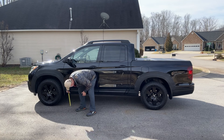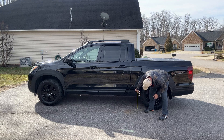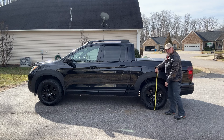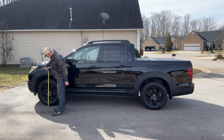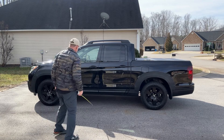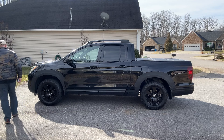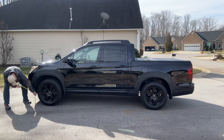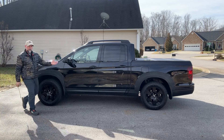Let's see how much it's lifted. To the rocker panel: 14 inches front, 14 inches rear. From the ground to the wheel tub: 34 and three quarters in the rear, and 34 and a half in the front. As you can see, it's completely leveled out.